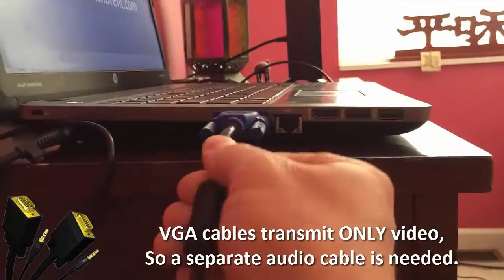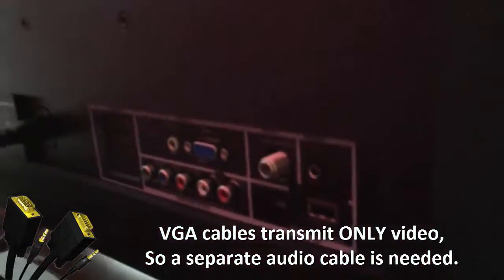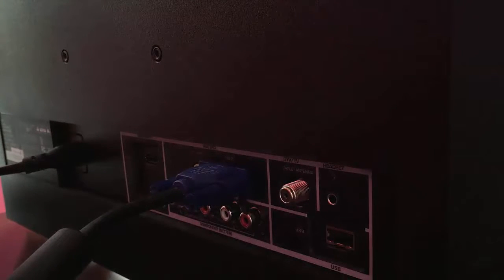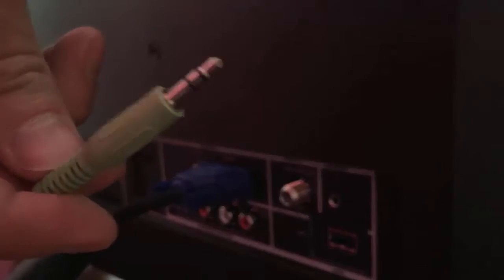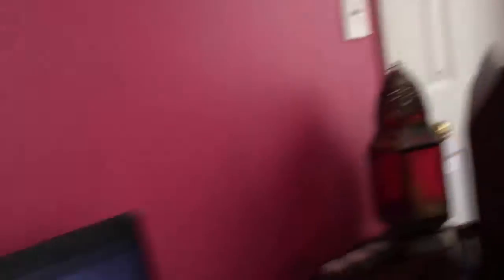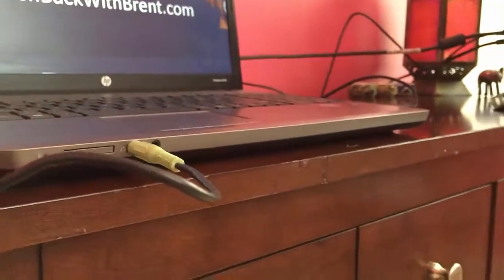Make sure that you plug that in and it's seated. Let's come over here, turn the back of the TV set, and look for the VGA. There it is right here. We take this VGA cable and plug it right in here. One thing to remember with VGA: this does the video, so you also have to connect an audio cable. Here is an audio cable, and right over here is the audio input on the back of the TV. Then I'll do the exact same thing over here on the front of the computer — it is the headphone jack. And there you go.